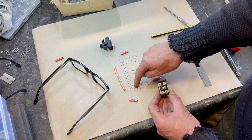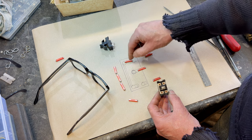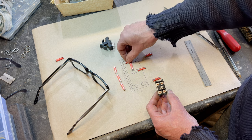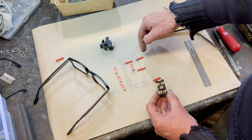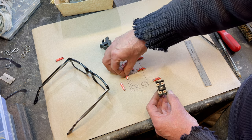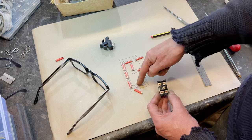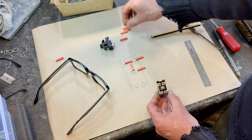Now, if you don't put anything on that connection, when you bring that into play there, obviously you're connecting those two. The live going from there to there, that's inside the switch. Maybe I'll put one of these in there to show that's happening. So that's connecting that permanent live to that one, which has a wire connected to here, which is taken off there to raise or lower the windows, depending on which way around you've got it. But as I say, it's also livening up this connector here. But if you're not using that, it's not plugged into anything. It's going to be live, but it's not actually going out of the switch anywhere because you haven't got a wire on it. So it pays not to connect it, if you don't need it, which we don't for what we're doing.